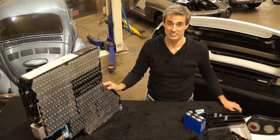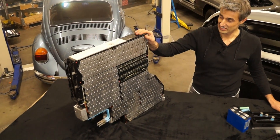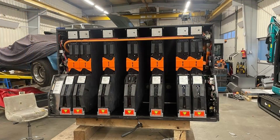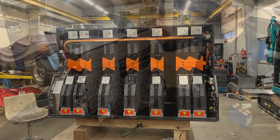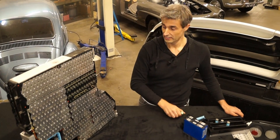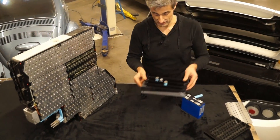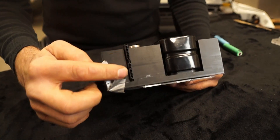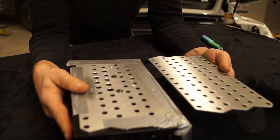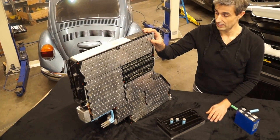With this improvement, I'd like to explain a bit more about our design process, because I think that's quite interesting. As a start, we looked at the original design. As most people know, there are 11 sheets installed in the battery pack, and there are a lot of 18650 cells — really small laptop batteries — inside. At first we thought we had to make a copy of it, so we experimented a lot. We made molds and even a special cooling tube, and we experimented with wire bonding. We bought an experimental wire bonding machine, all to make a copy.